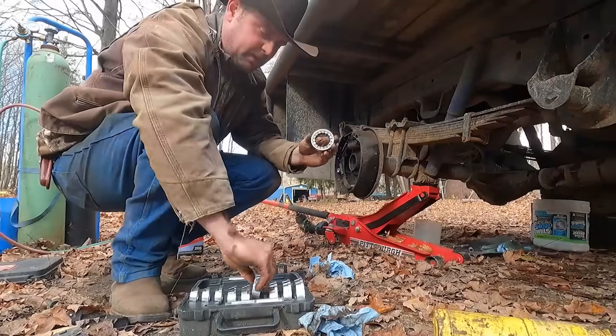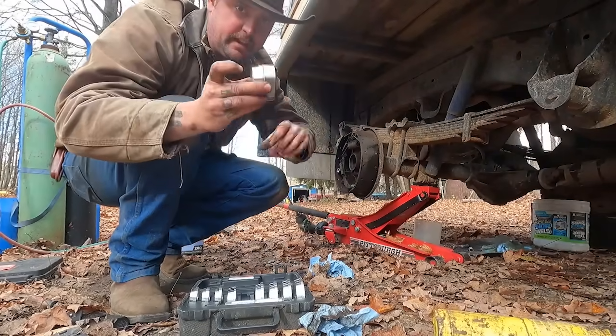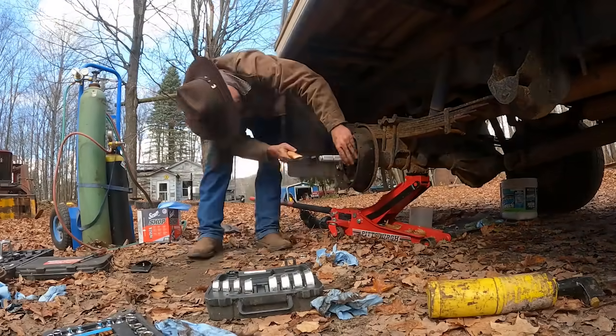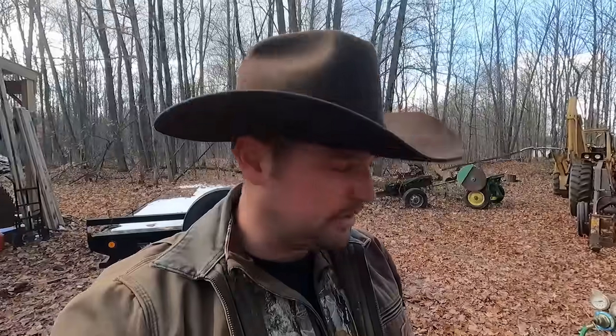To get this back in, we're using a bearing driver set. You want to use the size that's just a hair smaller than the bearing itself — that way it provides even force while it's being driven in. And there we go — pretty simple. The biggest thing is just make sure you're tapping it in evenly, because if it gets cocked to the side it can warp or bend something. Just go slow and make it happen. And just so you know, there's no law that says you can't use a hatchet to tap in a wheel bearing — that's a common misconception. Now all we've got to do is the reverse of what we did to take it out: put a new gasket on the diff cover, fill it up, and see how she does.